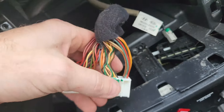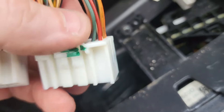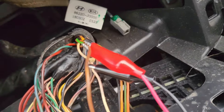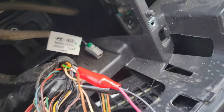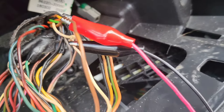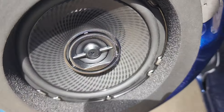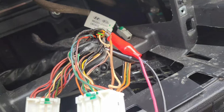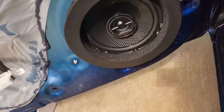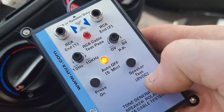I found the speaker wires — I can see the ones that come from the door. I'm pretty sure that these eight right here on this corner are all your speaker wires. I got my wire leads connected to these wires and stripped them back just a little bit. What I believe is positive is brown and negative is white. Now you know that speaker wire is for the left front. While your wires are hooked up like that you know it goes to your left speaker, but you want to check polarity now.